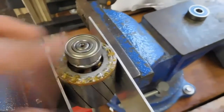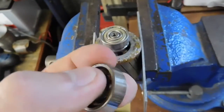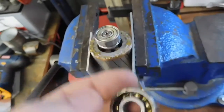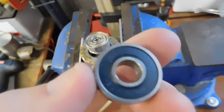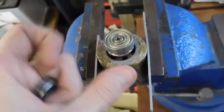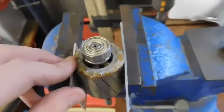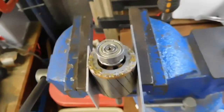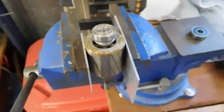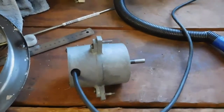I've just got the new motor bearings — this is the rear side. I thought I could try and re-grease them while they're on the shaft, but they're just that bad that I might as well replace them. That one seized up because I had to heat up one side to pull it off. There's the new one for the front — these are NSK bearings, very good quality, and they are dead quiet. So it should cut down a bit of the noise that the fan made. I remember listening to that old thing rattling away — it pulled a good amount of air but it was just so noisy because of the bearings.